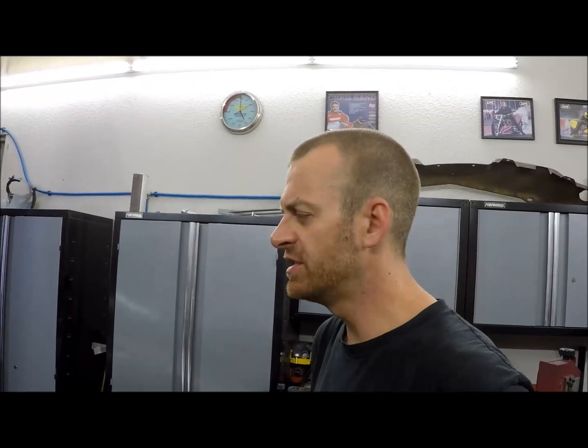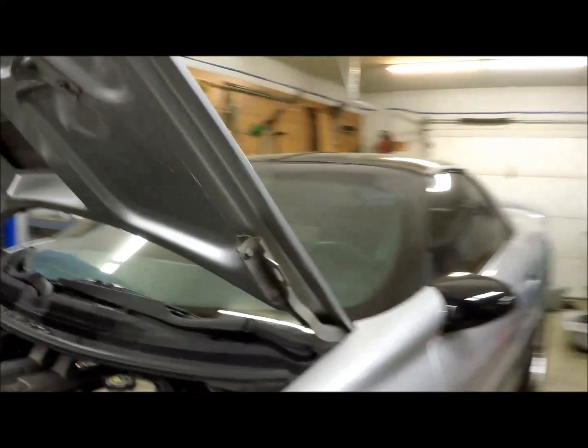What is it? It's a Magnum transmission. So the T56 Magnum that's in it right now has a conversion mount from, was it BMR? Oh shoot, yeah, BMR. So it's got a conversion mount. It's got an aftermarket transmission mount in it from when it had the LT1, because it had a little bit newer transmission in it. I was actually able to modify that just a tiny bit, and it is within about 1/4 of an inch. Oh, nice. Let me go down here and take a look at that factory. Look at where we're looking here.